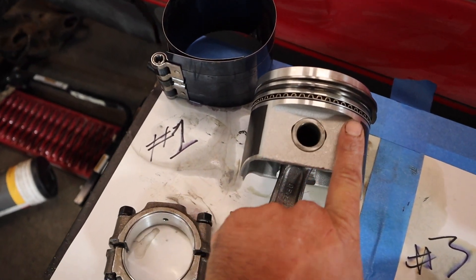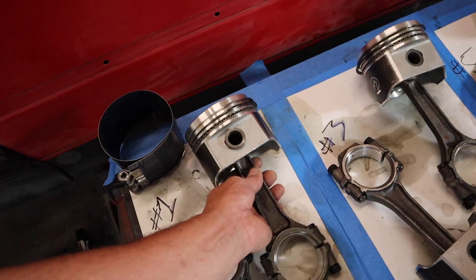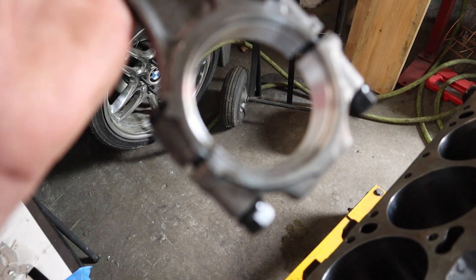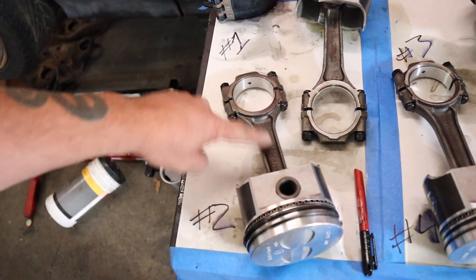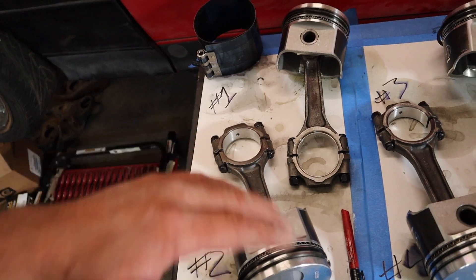You can see this space is dramatically different on each side. You've got to put the number one piston into the number two hole, and make sure you put the chamfer of your connecting rod towards the counterweight of the crank, because that's what it's clearanced for. The idea is it leans the connecting rod at a better angle to the crank to give more push — more work sooner in the combustion stroke. Even Uncle Tony says it's something that won't show up on a dyno, just on your butt dyno — makes the engine more responsive. Compounding every trick you can to make the engine work better is what hot rodding is all about. I'm gonna slam these back in the holes and see if I even have an oil pan for this thing.